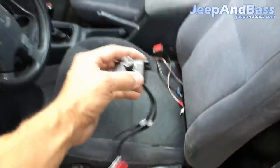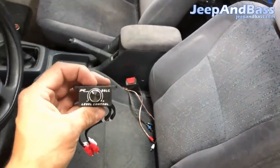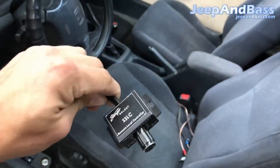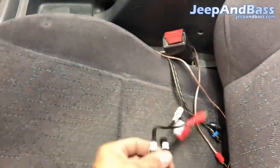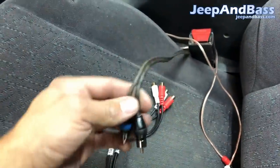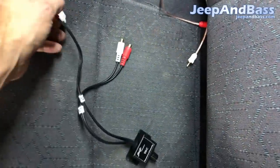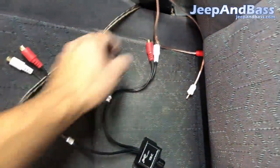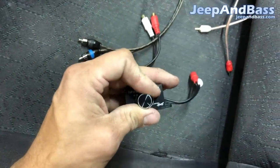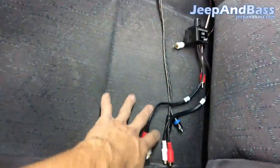So we're going to hold on to this amplifier bass knob — I have another plan for that. What we're going to learn today is this RCA bass knob. It's labeled input and output: the input is the RCAs coming out from your sub output on your stereo — I got a three or six foot cord. Hook those RCAs up, the other pair goes to the amplifier. Turn the knob up, you gain loudness; turn it down, and all the way down it cuts complete signal.